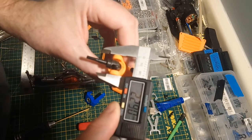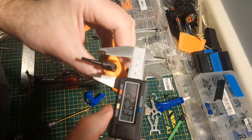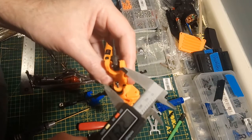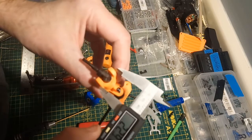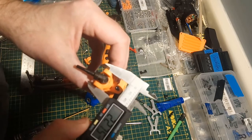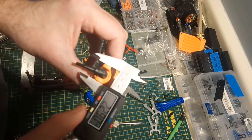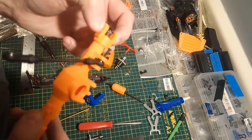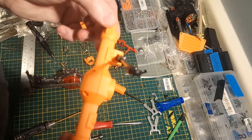If you don't care, because it's not going to make much difference in a non-driving car, just screw bottom, screw top, and you're good to go. Then you put a pin in, put a hex on, put a wheel and tire on, and you're good to go — complete axle. This dimension out here is right around 23mm, just a hair less. If you guys have any other knuckles you want to work with this, check your dimension. If it's more than 23mm, it should work, because most of this type of deal has very similar geometry.